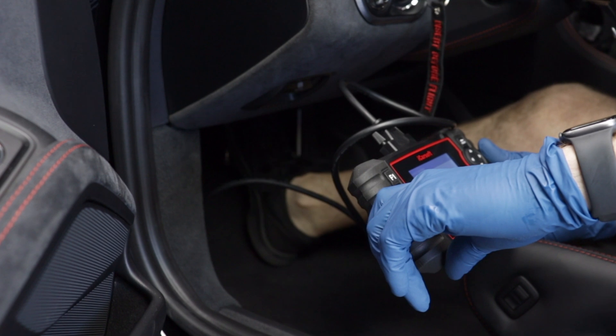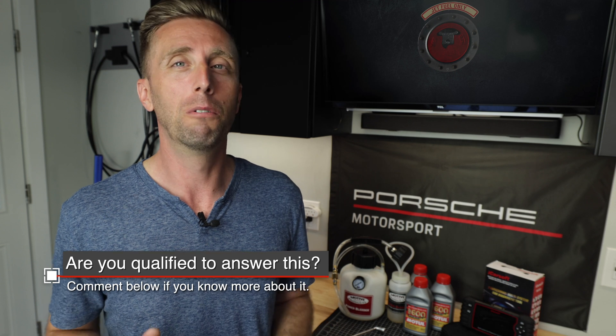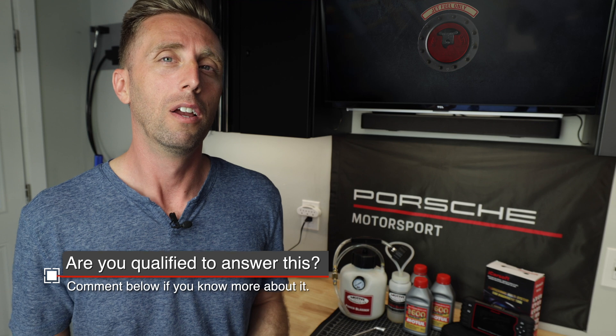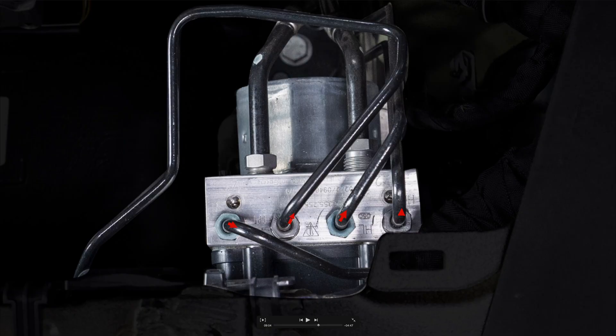It really comes down to that brake pedal pressure. Some people might argue that these valves aren't always opening and closing, so even after flushing, there's still old fluid in there that doesn't move around as much — it could be corrosive, hold moisture, or trap air bubbles. If that's the case, your process is not complete and it may degrade the ABS module over time. I can't vouch for that information — I've never really found any good proof of it. But if you think that might be an issue, go ahead and bleed the ABS module.